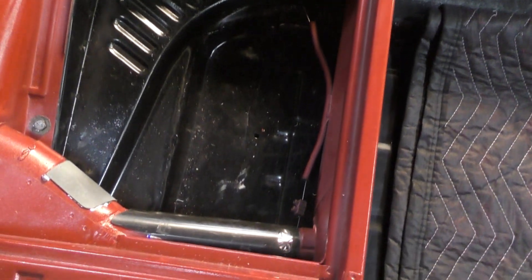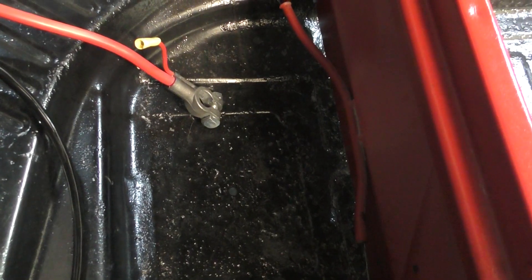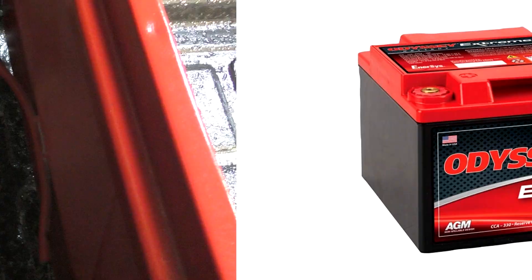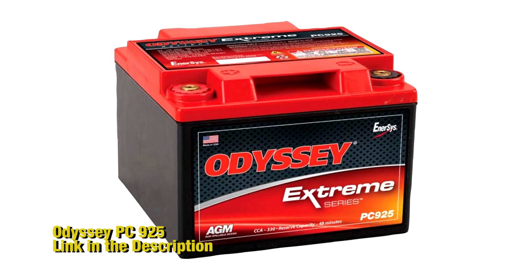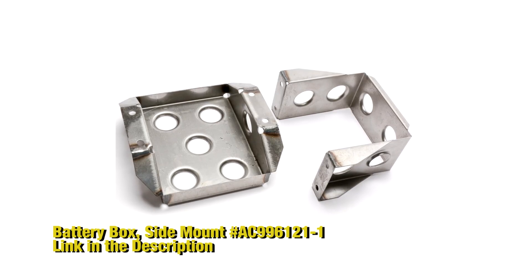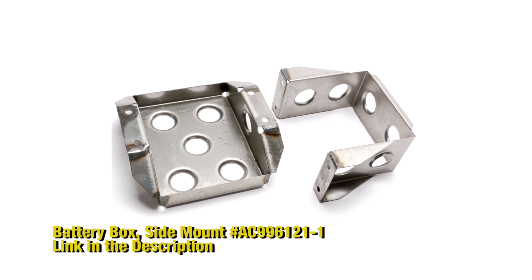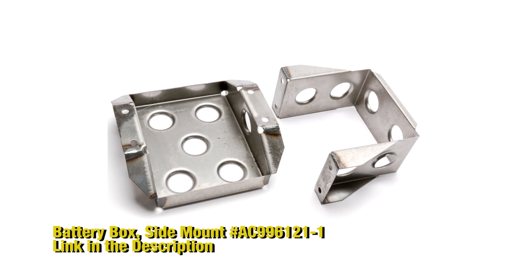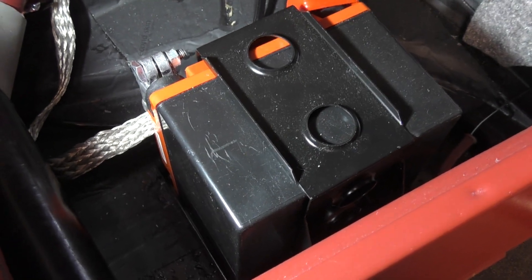The battery has to fit into the small area between the tunnel and the heater pipe, and it can't hit the support bracket under the back seat or the conduit for the heater cable. The battery that fits back here is called the Odyssey PC925. The side mount bracket that holds it in place is made by a company called Latest Rage, part number AC996-121-1. I'll put a link in the description below, but you can get it on Amazon, Appletree Automotive, or any number of places.